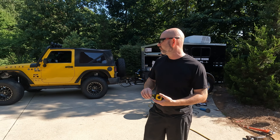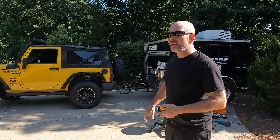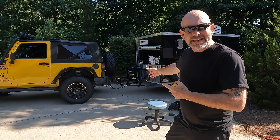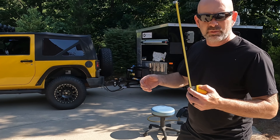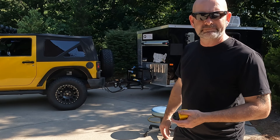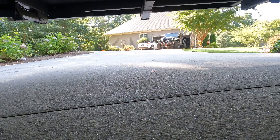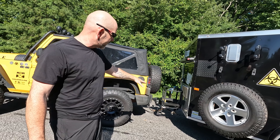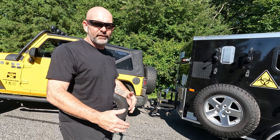We did the video where we showed the rescue wagon and Roxy really sagging when we went to the Outer Banks, and it looks pretty good right now. When we get to a flat surface I'm going to stand on it to give like the additional weight that will be on there with a few things we'll be adding. Then I will have Stacy measure the front and make sure that we're still not too high. If so, I can adjust it up a little bit and that will counteract for the weight. Even with the sharpest turn I've got plenty on both of the weight distribution bars so I don't have to worry about them falling off.